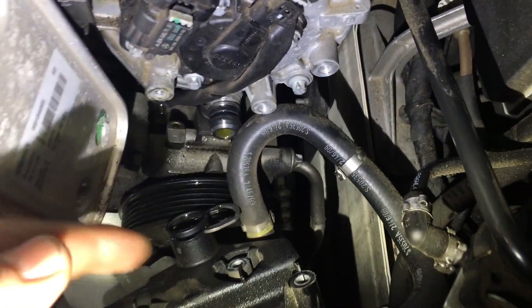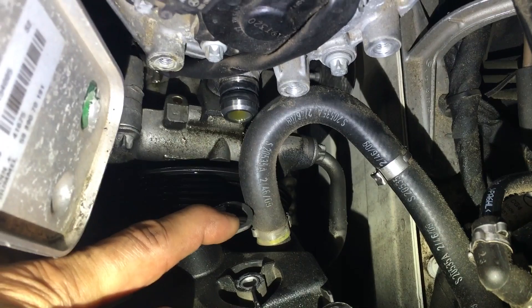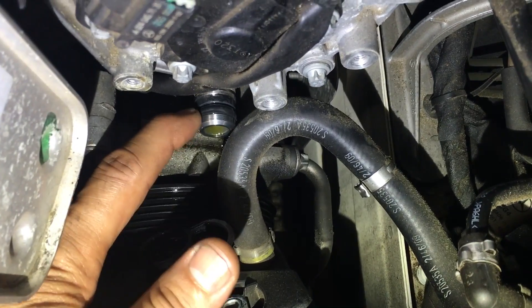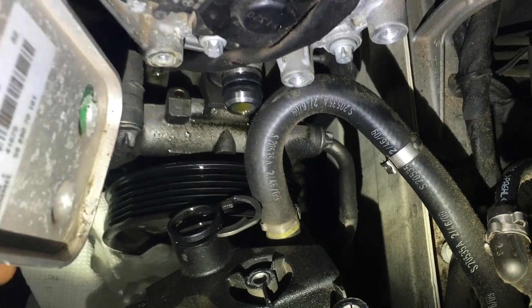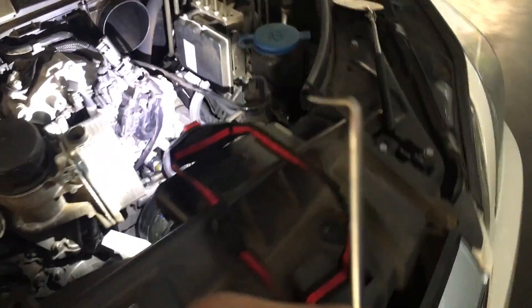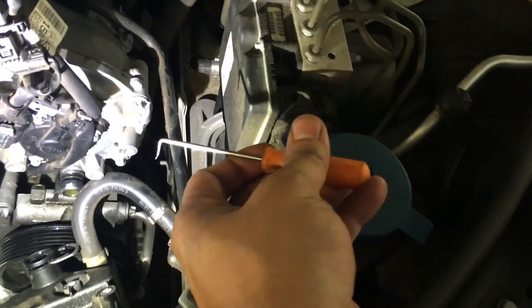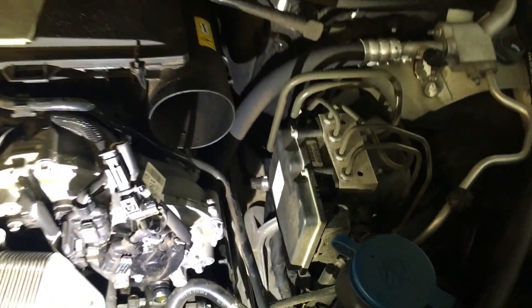You also have to remove from the back a kind of cotter pin that secures the reservoir on the steering pump. You have to use a small screwdriver, come to the side and push it a little bit. Then I used one of the picks that has a bend on the side — go through the back, get it in there, wiggle it in, get it out, and then the reservoir is off.